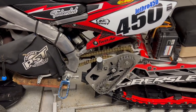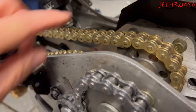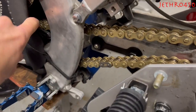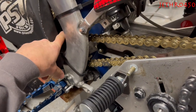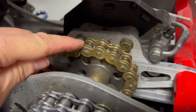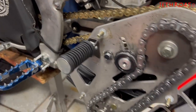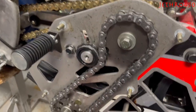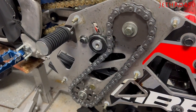This video wouldn't be complete if I didn't talk about the gears on the drive of your bike. I have a big old strong super bike 1100cc chain on here — it's been awesome. The gears from the bike to the drive back here work exactly the same as your dirt bike: bigger up front speeds it up, smaller in the rear also speeds it up. Right now this is a 17 and I've got a 13 up there. Before I started messing around with this, I wanted to put a 14 up here — with everything slowed down, I wanted to speed everything up by one tooth. But a 14 would not fit on my setup, so I ended up doing this instead. It's actually really easy to switch these gears around, so don't be afraid to do it.